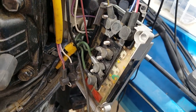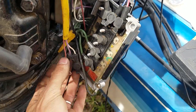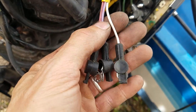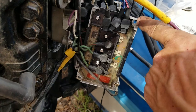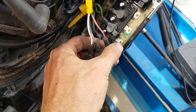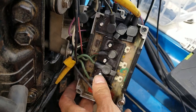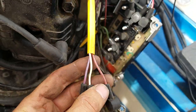It's a little tricky to understand, but think of this as an old VHS with lots of audio inputs. The trigger wires literally just have to go to the correct coil number — that's in the wiring diagram. It doesn't matter which of these channels you use. This box is just an intermediary mailman: it's getting mail in from the trigger and sending it out. The motor doesn't care what cylinder uses which channel — it cares that the correct wire colors are going to the right cylinder.